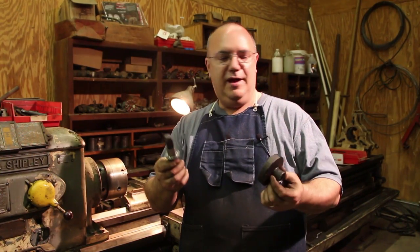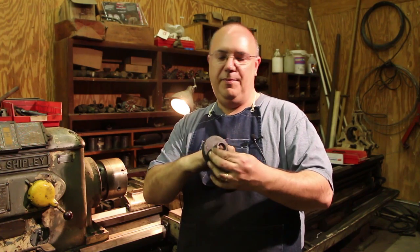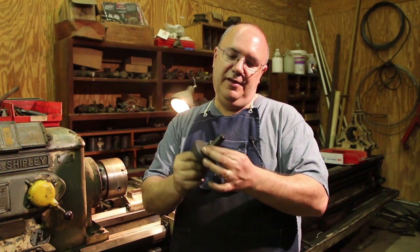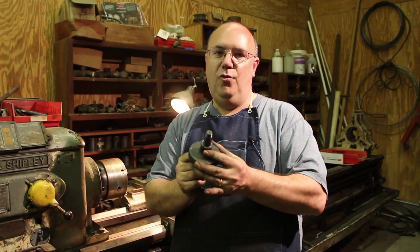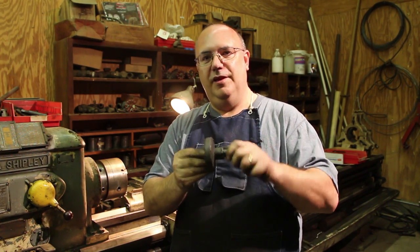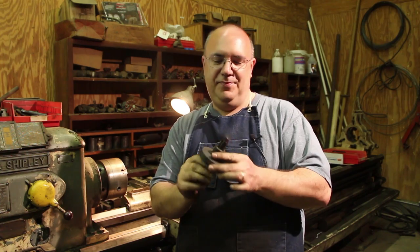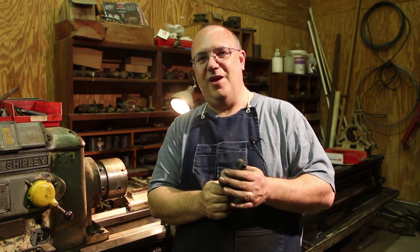All right, so that was a pretty simple job. Didn't even have to turn that — just polished it out. Took about twelve thousandths out of this, just bored it out. It goes together very nicely now, real tight. The other one had slop in it and was worn more at the top — it was bell-mouthed. That's a really nice fit. We'll let Tom get this put back on the Model T and check one more step off of that project. Thank you guys for watching, and thank you to all my many subscribers out there.